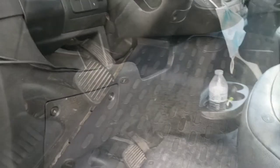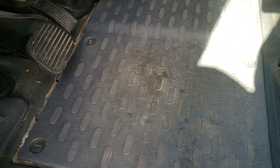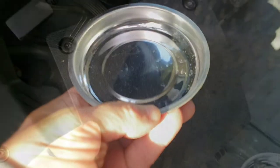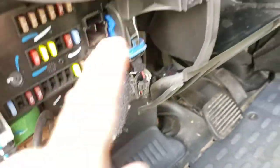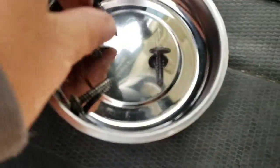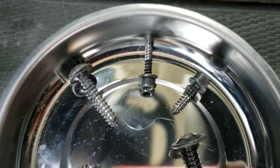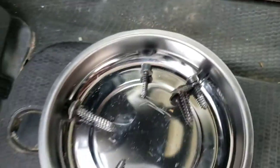This bottom part comes off with some screws here and a couple down there. Always remember after you've disconnected the battery to put the floorboard back down so you don't lose anything down in there. I also got one of these magnetic trays at Harbor Freight for about a buck to hold all your stuff. The small panel was two Phillips screws, the big panel was four Phillips screws, and the steering column takes a three-millimeter Allen wrench.